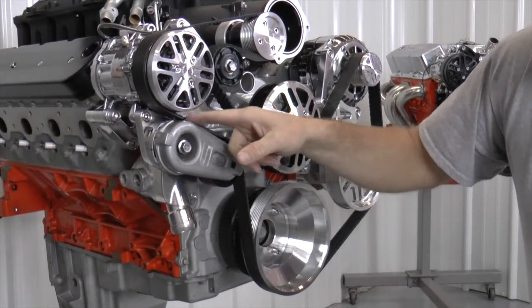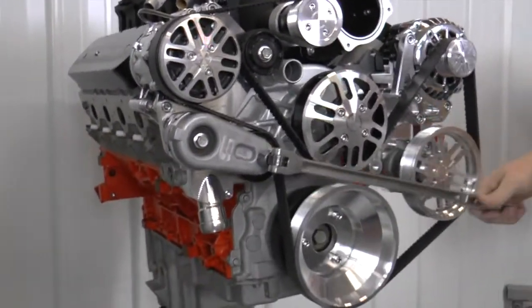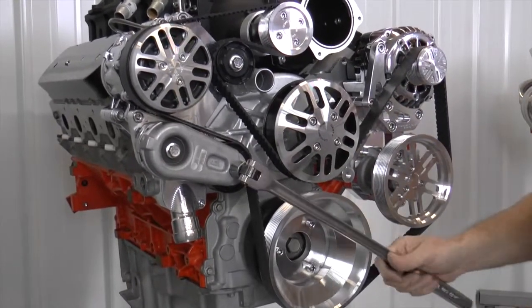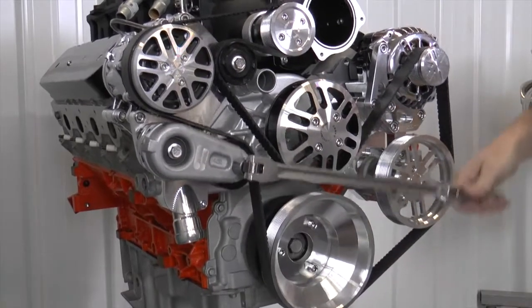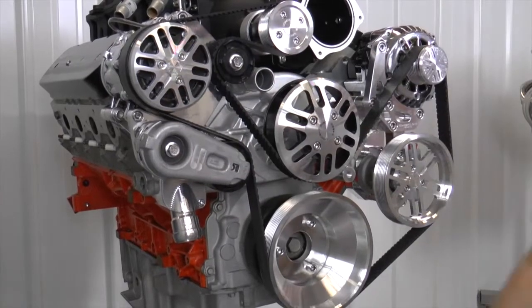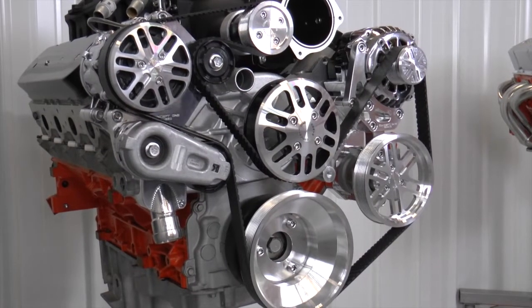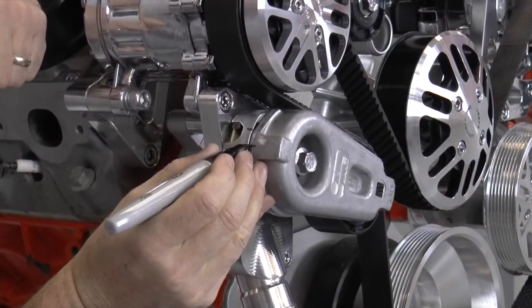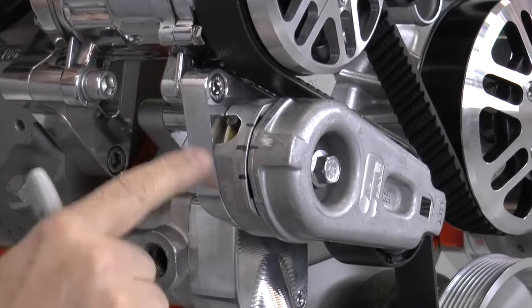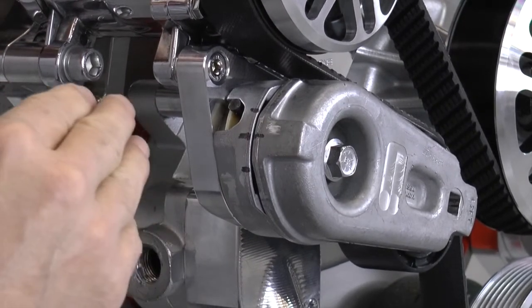See how close that is? You can just see how much this belt will pull when we pull on this thing by hand. Notice that a lot of times people call and say their belt's hitting their tensioner. Just pull on it like that — it'll release and it'll normally clear. Now, going back over here to where we marked the tensioner, you can see where we're running right here. We're a little more than 50% travel, which I don't want any less than that. If you can get one slightly shorter, that's best.